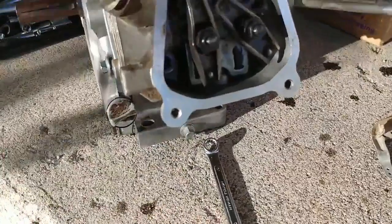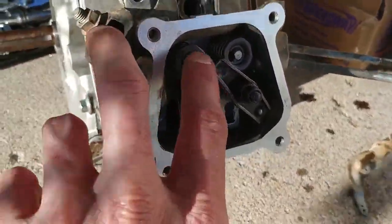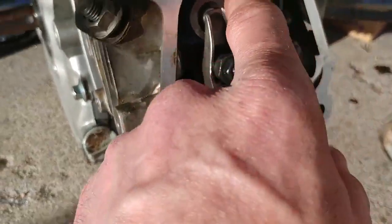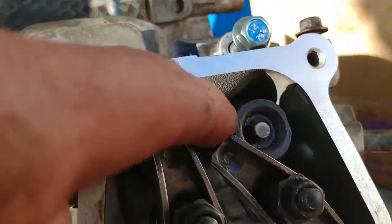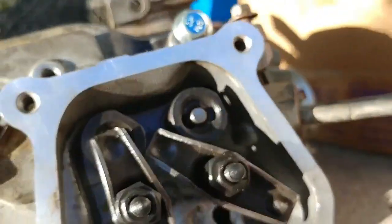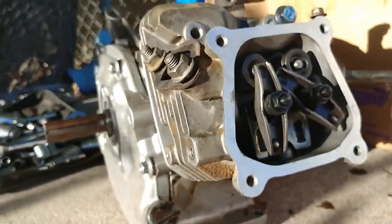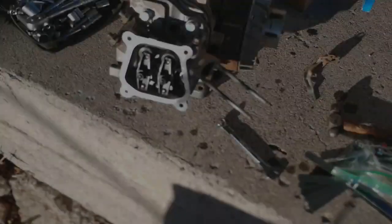All right, moving forward, I managed to get the 18-pound valve springs in here. I believe the lash cap goes on the exhaust side and the intake doesn't get one. I made sure that I paid attention when I pulled this engine apart because it didn't have the rubber sealer ring down there at first, but now I got one from the other engines. So I just got to get the head bolts torqued down to 17 foot-pounds, and we'll be moving forward with this project.